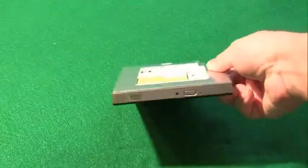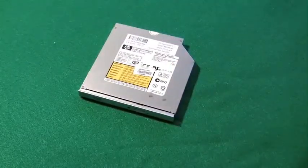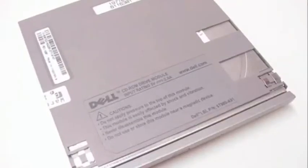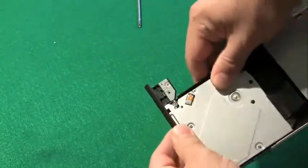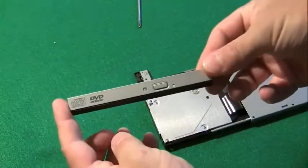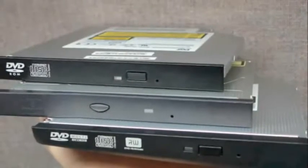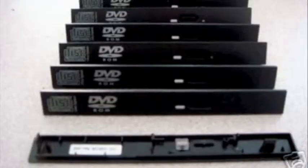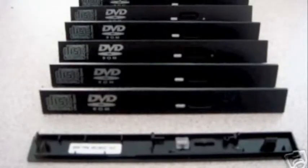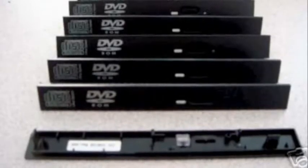Now let's take a look at the drive after we get it out. DVD and CD drives may look very different from model to model, but they're pretty much the same — they're just covered in a case or have a different front plate or a different back fastener. The front plate on a CD drive comes off and leaves pretty much a standard drive that could be used in pretty much any laptop. But don't think you can put this drive in any laptop, because though they look the same, the front plates are not universal — they have connectors that connect to the front of the drive but are different from model to model.